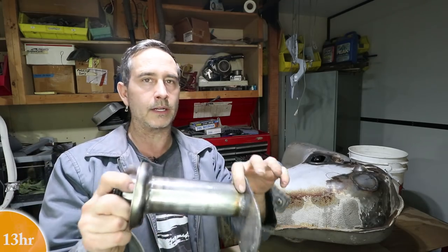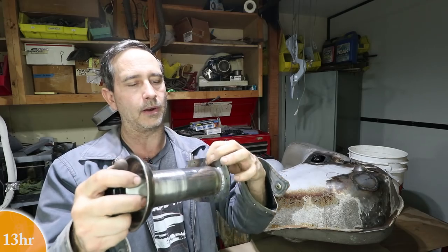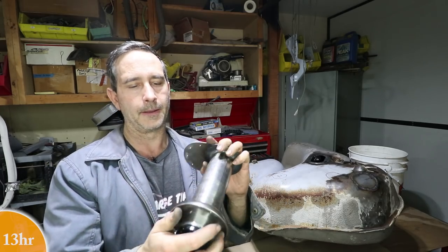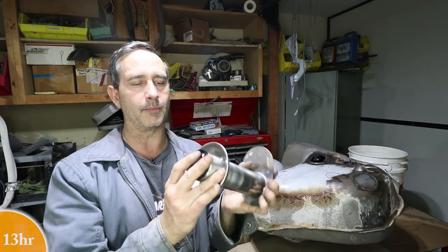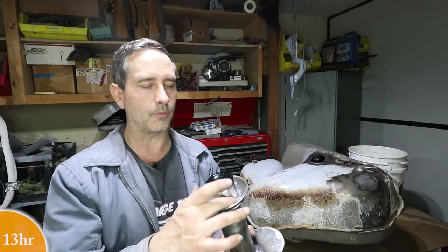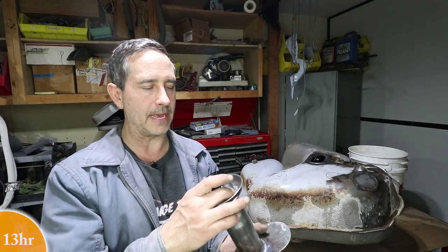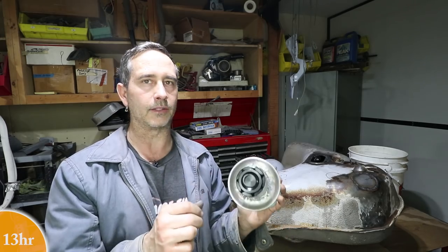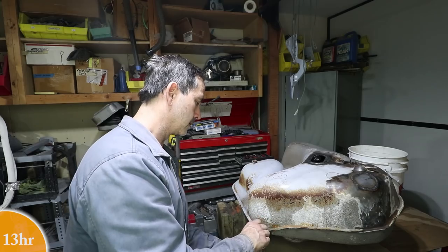And then I did weld. I finished welding all the way around. I came out one night and went all the way around, so this should be okay. And then same thing on this side. I welded it around on this really thin bowl. So it's gonna need a little bit of, call it body work, when I paint the bowl so it looks good from the top, because it's a little messy where I had to hammer and fix the welds on that. But I do wanna make sure it doesn't leak, so I'm just gonna put it here.